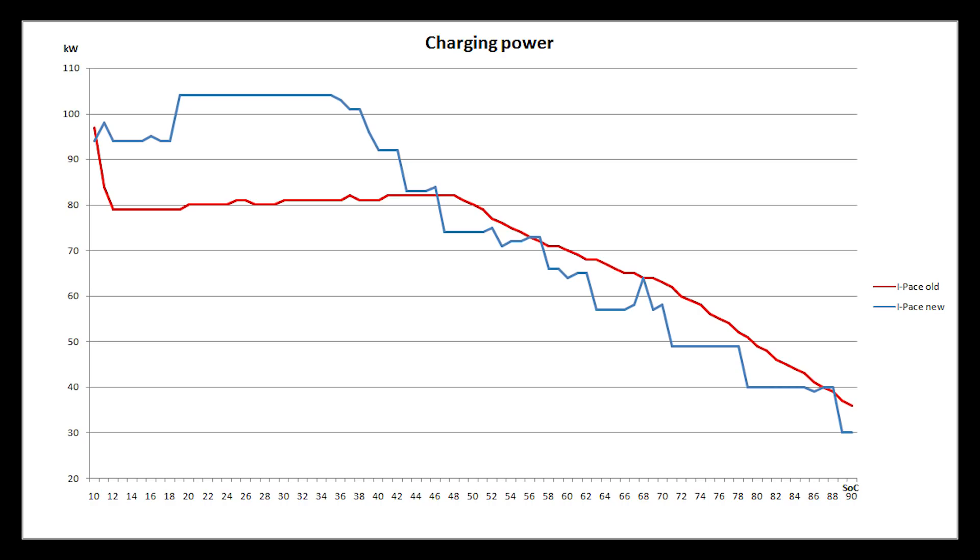It might just be that five kilowatt-hour of the top here is battery heater activated, so maybe we are only getting 100 kilowatts. Jaguar never said they would charge more than 100 kilowatt — they said 100 kilowatt, not 105. Past around 50%, the old one had a much nicer and flatter curve, which is the reason why the old one finished to 90% faster. My theory is that when the car is charging at higher C-rating — say 90 to 100 kilowatt — you have more losses. By pushing power higher, you're sucking more power from the charger to charge a little bit faster, but you also have more losses. If you start driving right away that's fine, but otherwise the battery will start cooling down and that heat is lost. The old curve was flatter, meaning lower losses at high state of charge.